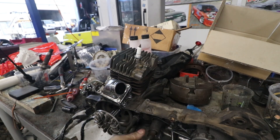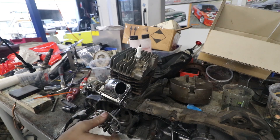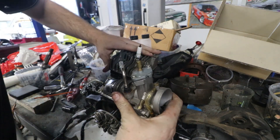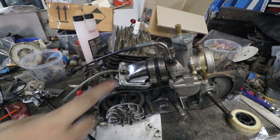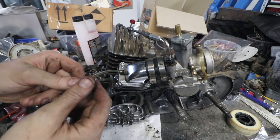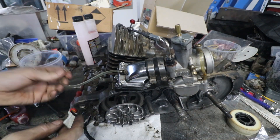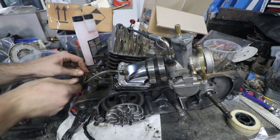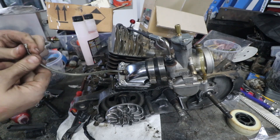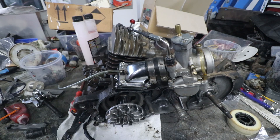I'm missing a lot of parts for the driveline of this, but I just screwed this back on so the starter flywheel is on there, so we've got something to start it off. Last thing to chuck on is the carb. There's no vacuum lines or anything needed here — the only line is for the oil feed. We're going to run it off oil mixed in with the fuel rather than oil injection just to start with. I might just put something in the end of this to plug it for our test runs, and then we'll set up the oil injection once it's actually in the scooter.